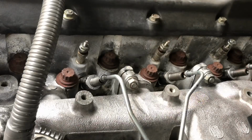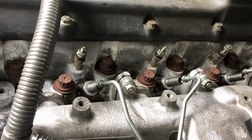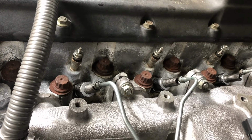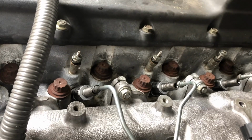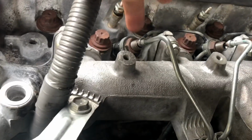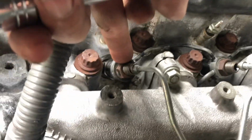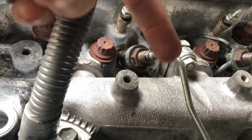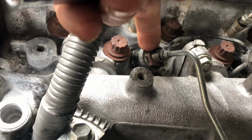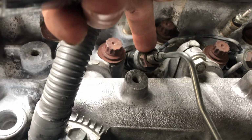Anyway. Okay, I've just done up the injectors. The torque setting on the torque wrench is 54 Newton meters, and as I said, it's the 21mm deep throat socket that I used on the injectors to do them up. Okay, I've just done up the return line nuts, which are these ones here. They're 13 Newton meters and a 17 mil socket. Did I say 13? I meant 30 Newton meters to do those up.